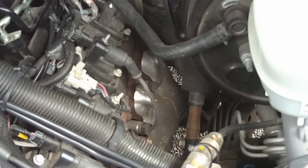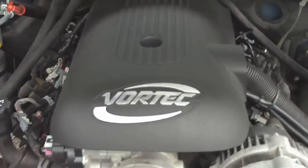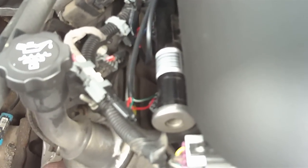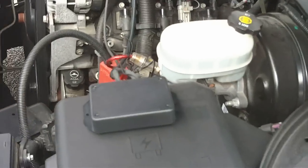I had a mechanic help me because I'm not too mechanically inclined. We'll come over here to this side. All these do is hook into your fuel injector wires here. All it does is intercept your computer signal and make an adjustment for alcohol. It's actually pretty cool. So if you're interested in converting your vehicle over, this is a fairly simple way to do it.